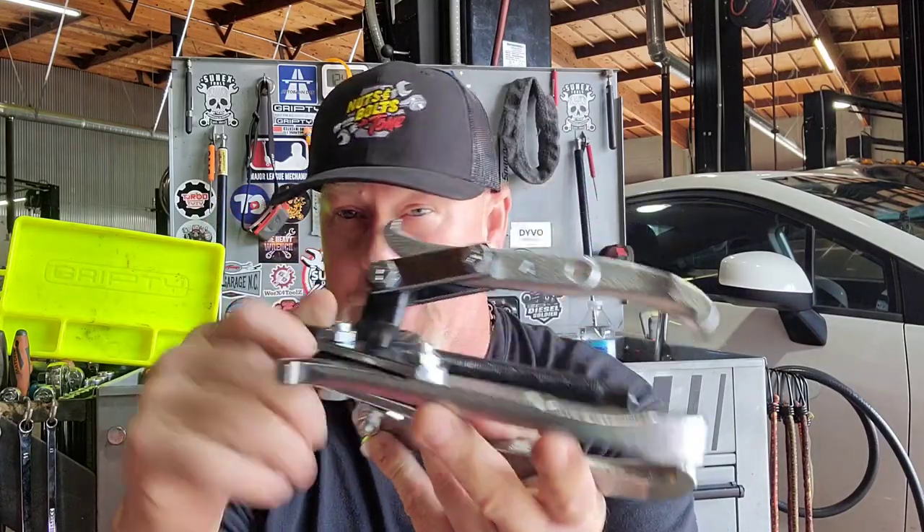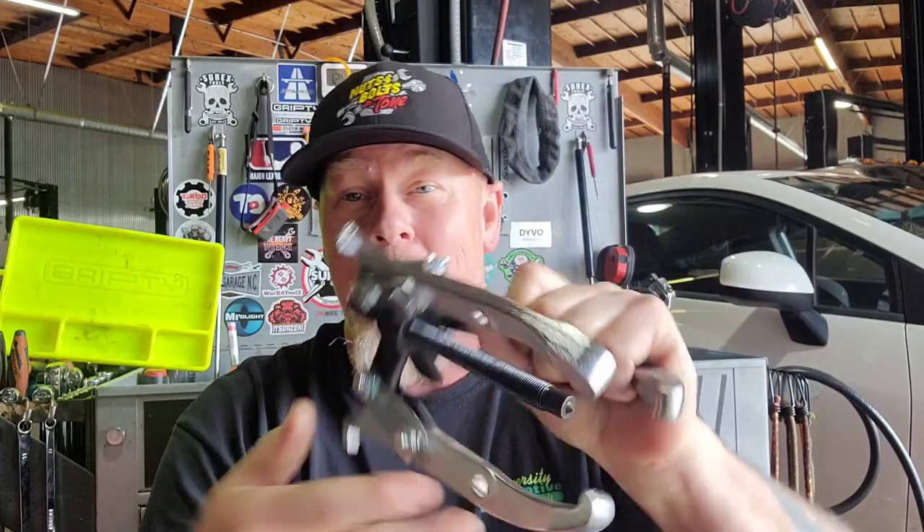I think it was about a hundred bucks for the two of them. This is really cool because usually when you buy a tool you don't get to use it for a long time. But yesterday I was doing a driveline on a Toyota Tacoma — had to replace three U-joints and the carrier bearing in the middle. I was able to air-hammer off the carrier bearing rubber part, and all I was left with was a sleeve. I got this brand new, literally just got it, and I walked over to my cart, took it out of the package already set up, backed the screw out, set it up, pushed the arms in — it's super tight. It held it nice and I just ran it with my cordless impact and pulled it right off.